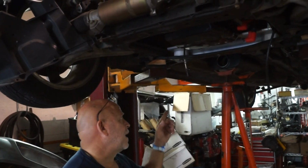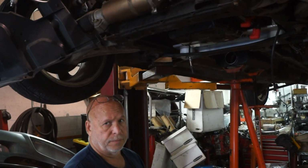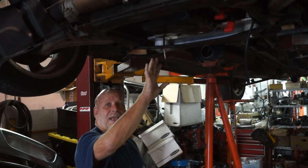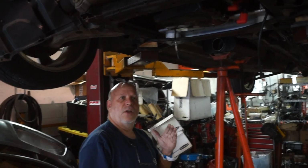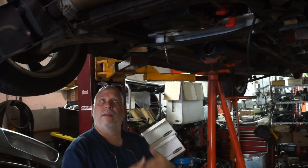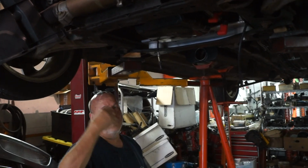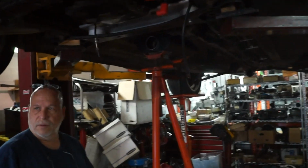The bigger that can is, the deeper the throat and the more torquey the engine becomes. But it will not work on an NA rotary. The pulses of the engine will begin to bounce off that V and bounce back into the motor and create reversion through the intake system, choking the engine. It's like constantly hitting a wall. But after the turbo absorbs all the pulses, from the turbocharger back, it's basically a smooth column of air.